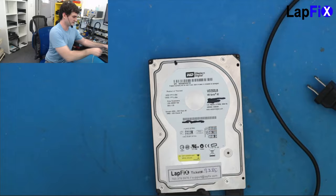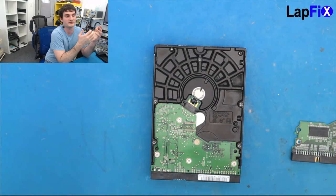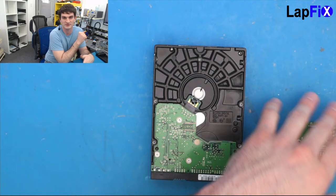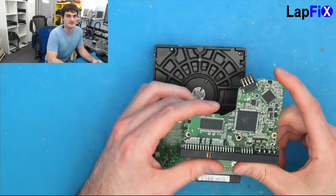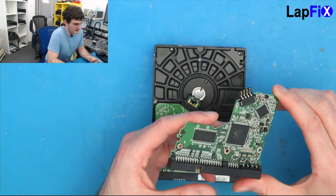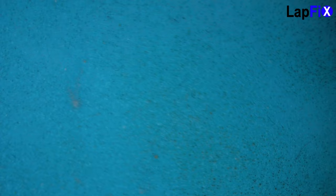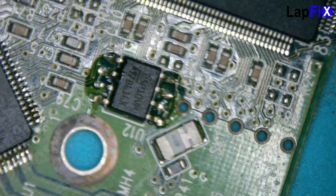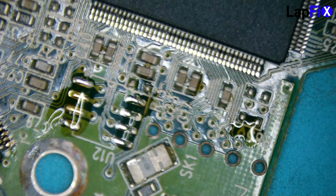We can take the power off now since we don't need it. Boards are made in different places, manufactured a little bit differently — some chips could be a little bit different, the firmware could be different. We're really going to focus on the firmware. What we're going to do is take a look under the microscope. When you get these types of boards, you need it exactly the same. Sometimes you need donor boards not just to replace the whole board — what we want to do is replace the firmware chip on it and see if that's going to help make it read the data.